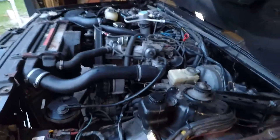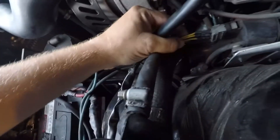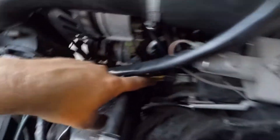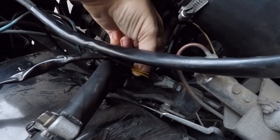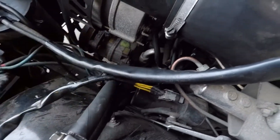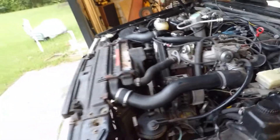After that I strolled my way up here and tested the vacuum pump — it's right here, that's the vacuum pump for the cruise control. It's got three wires going to it which I had to replace because they were shot. There's a power wire on the very bottom, and if I'm not mistaken the other two wires are grounds. I just took some old wire and ran a direct feed from the battery directly over to it to verify that it works — and it works.